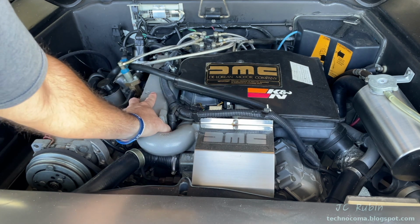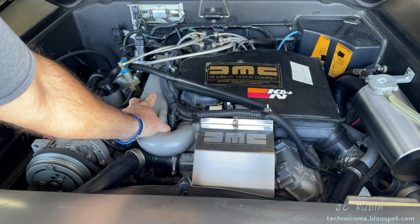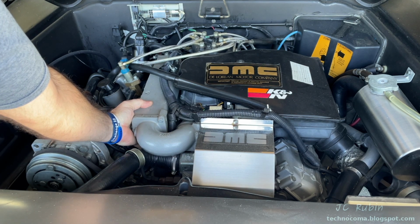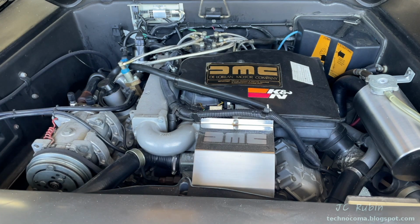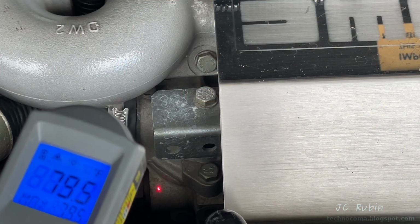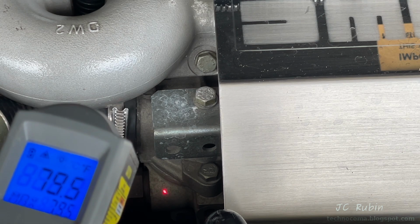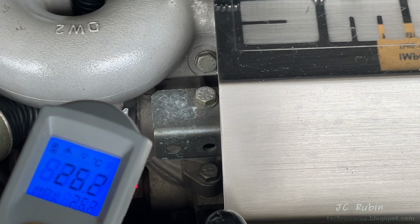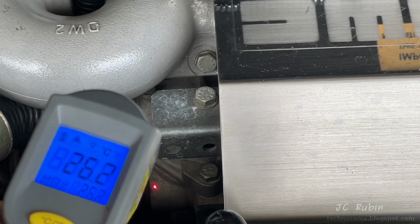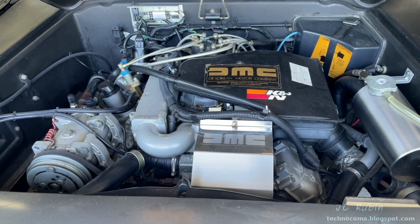And as we can see, for our purposes, this engine is cold. I can put my hand on the manifold, I can put my hand on the valve covers. The water temperature is not 35°, it won't inhibit the cold start valve from operating. More specifically, the coolant temperature is less than 79.5 degrees, or in centigrade, we're looking at 26.2. Trying to start the engine will give you 10 minutes of this.